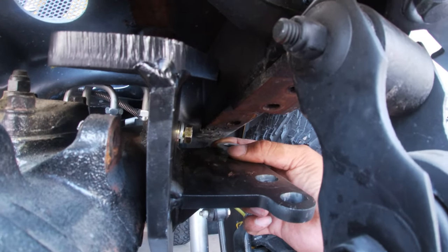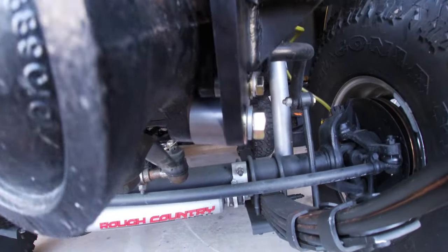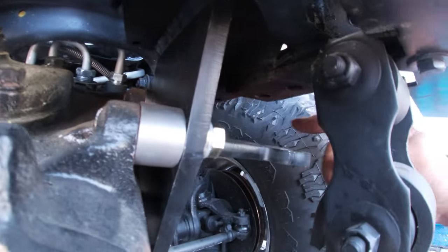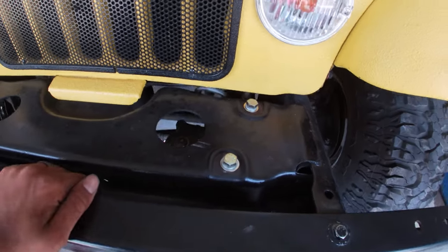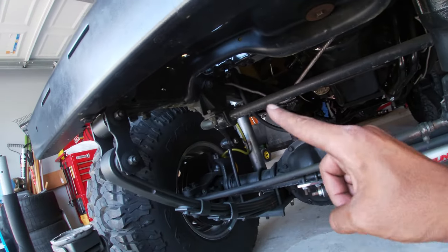As you can see, the spacers, washers, and locking washers are all in — those are the four bracket points. Now let's finish putting this all together. Of course the last spacer goes on the very back to make up for the bracket at the leaf springs, so everything is nice and even. Almost done — this is the home stretch. All that work was totally worth it. Look — we've got the two Grade 8 hardware bolts there, and here's the new bracket. Heavy duty — I love it when a plan comes together. Now the next step is putting on the brace.